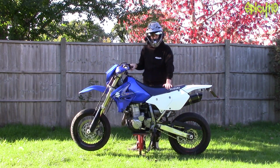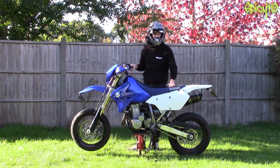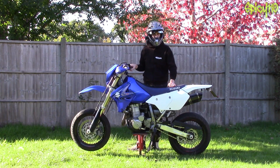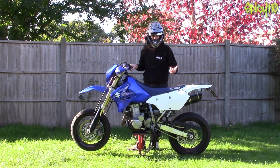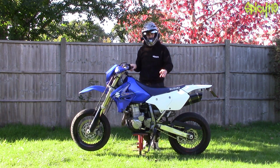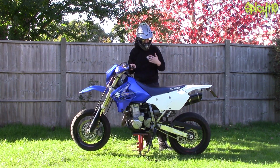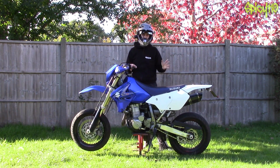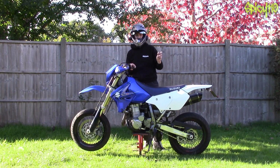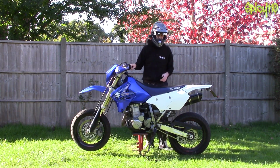The next thing down the bike is battery in most cases. If you don't use your bike a lot, or if you don't ride it during the winter, I really strongly advise that you get something like a battery tender, an optimizer, that just keeps the battery charged over the winter, because what will end up happening is it'll die. To my understanding, interestingly, batteries actually get killed in the summer in really hot heat when they get baked in the bike, and it's not until the winter that they start to show their problems. I don't know if that's true or not. It'd be very interesting if anyone can add anything to that. Either way, if your battery goes, it goes, whether it's hot or cold. But it seems to always happen during the winter.